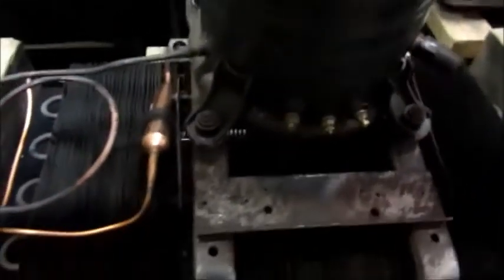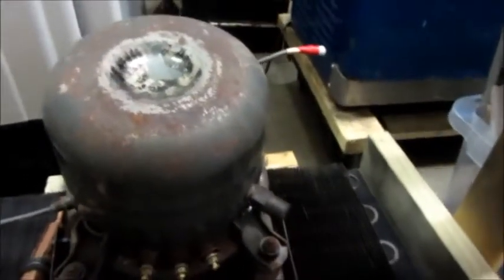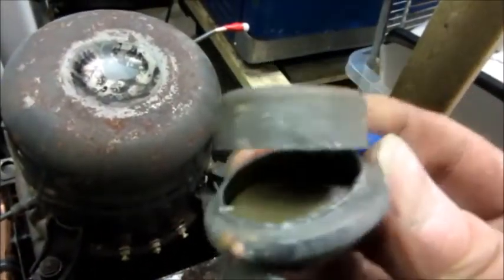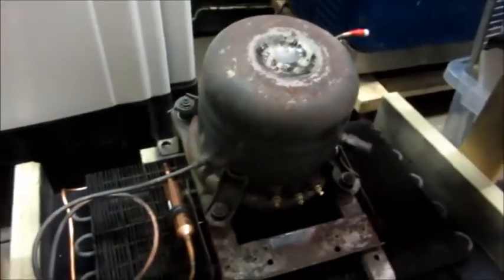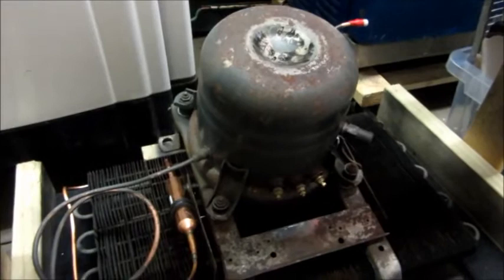I haven't clear-coated it or done anything with it — we're contemplating sending the cabinet off to be repainted, and until we make a decision on that, this is going to wait. I did make a modification: I went ahead and installed a regular Schrader port so that since this one's being shipped home to another state, if someone else needed to charge it they'd be able to use their regular gauges. I took apart the old filter — it was not a dryer, there was no desiccant, just a screen in there. So it ran 70 years with no dryer — imagine that. Now we've got a pretty good oversized one on there. That's going to be video one on the Kelvinator — hope y'all are enjoying it, and hope to come back soon with news on the cabinet and getting this cooling unit going.